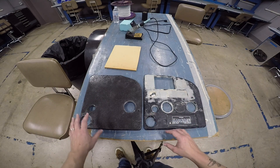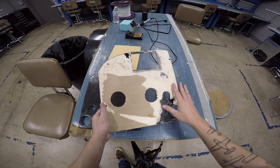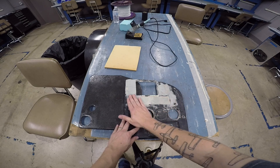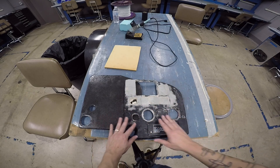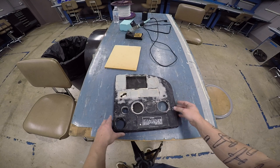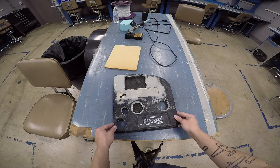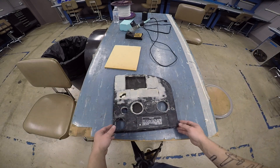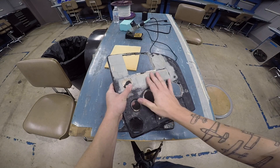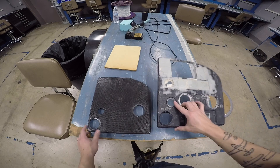I've got new placards coming for this, so don't worry about that. This was the original plastic overlay, and what I had done in those videos was filled it with some expanding foam, then I took Bondo, blocked and sanded the foam down, and filled all this with Bondo, then blocked everything down where it was nice and smooth — including this hole, because this is where the maintenance knob goes. Then I tried to lay carbon fiber directly over it. I put a lot of wax on it so that it would just pop right off. I put it in the vacuum bag, and I came in the next morning and under the pressure of the vacuum, this whole piece had just sort of collapsed. The Bondo right here cracked and it just looked terrible. So I ended up scrapping that idea.